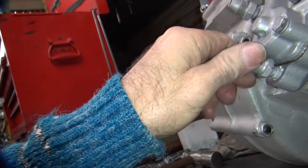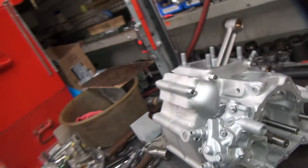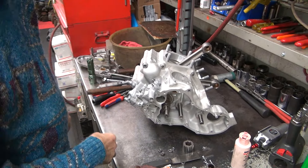Later on they made a taller one that was taller up, so that's going to be a problem. I don't want to jam it in every time because when I do it's going to try to break this pump off. So what I'm going to have to do is either put a taller one on there, which I don't have, or I'm going to have to turn the disc down a little bit — which is what I will do. Or I've got to go in there with a grinder and put a little divot in there right where that mark is — right there you can make a permanent repair. I kind of like doing the grinding part. So for now I'm just going to leave that in there so I don't forget it, and I'll have to plug that hole up with some paper before I grind next to that hole, because that is our feed line for the oil pump. You've got to remember to do that.